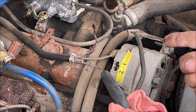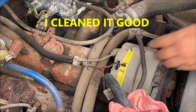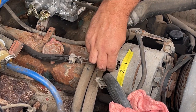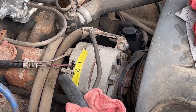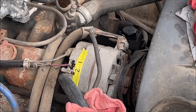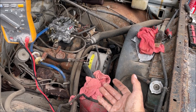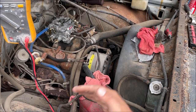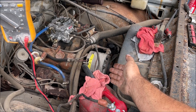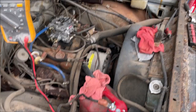The test we're going to do now is hook that wire straight to number two. As I say in my other videos, number one does not even have to be hooked up for this to work, but you have to rev your engine up a little bit - usually about 2000 RPMs to get it to start charging. So when we start this up it's not going to charge until we rev it, and then it should start charging. Hopefully since we have number two cleaned it's going to charge within that normal range, under 15 volts.